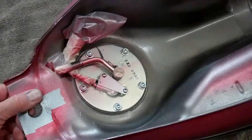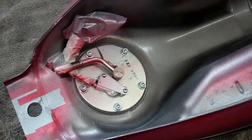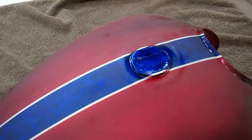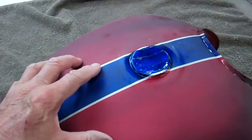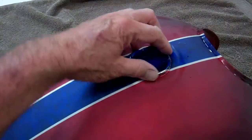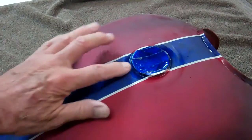You'll notice I took the grommet out here — put that in a bag and don't lose it. I'll show you how to put it back in when we're finished. It's hard to get every speck of gas out of these tanks because there's a sleeve that goes down inside. What I did is I left a fan blowing on the tank past the opening, and it kind of dried all the gas out. I left it for about a day and a half and that seemed to get rid of most of the residue. Then I masked it off for the painter.